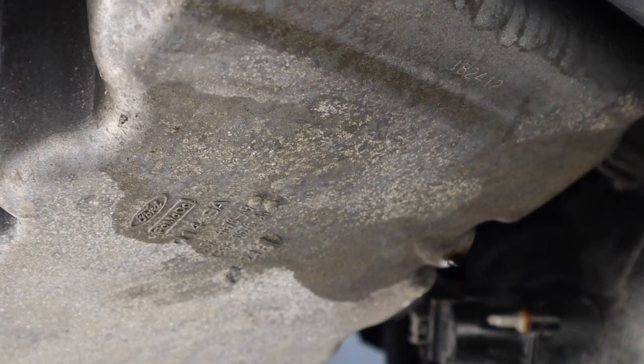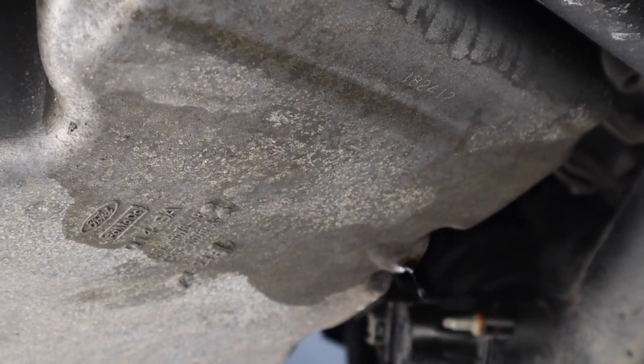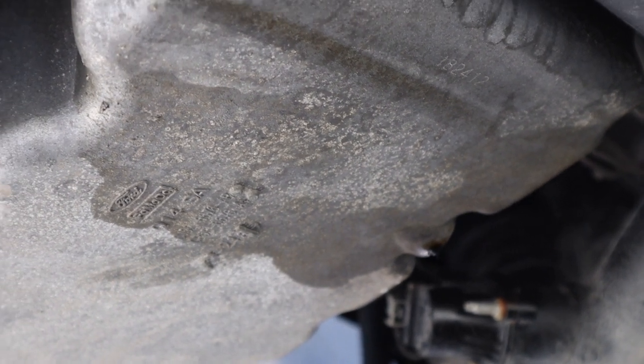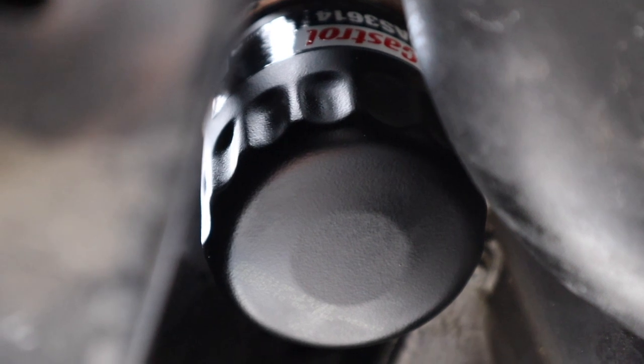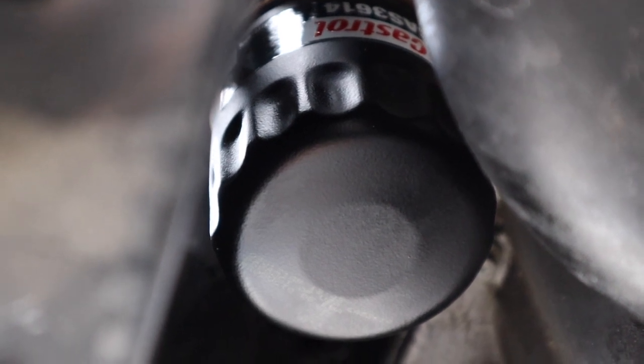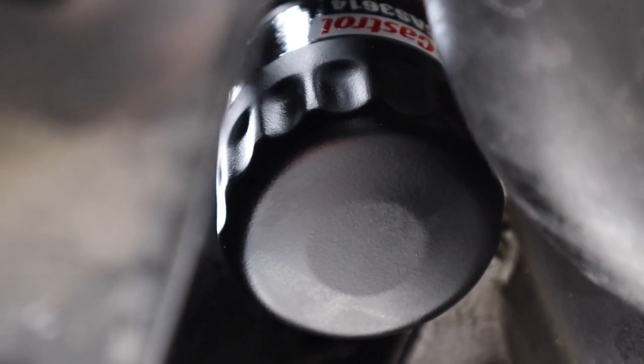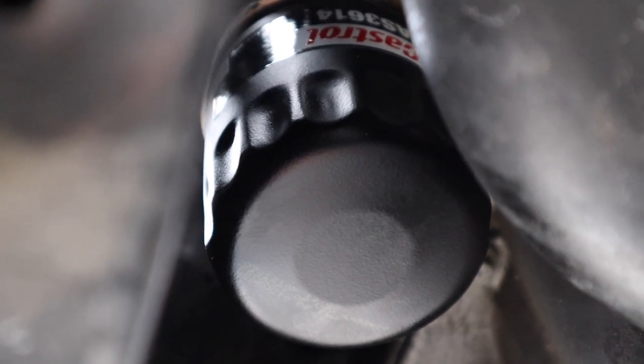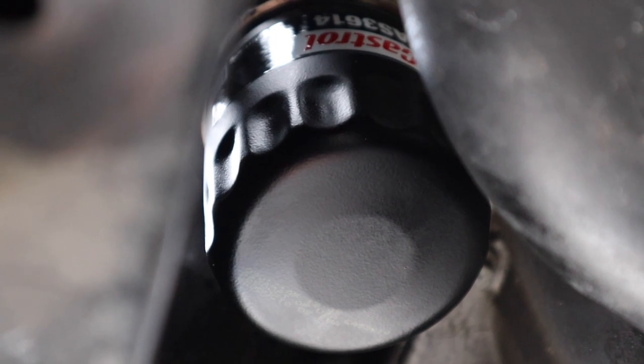And you can see I've now brake cleaned all of that stuff off. Just a hair of a rag touch on the drip before you put the drain plug washer back. The Castrol filter fit very well and threaded in. Torque spec is the rag covered power of a decently strong person. No strap wrenches on this, okay? This is a good filter. I did not pre-fill the filter. You can do that if you want, subtract it from your total.